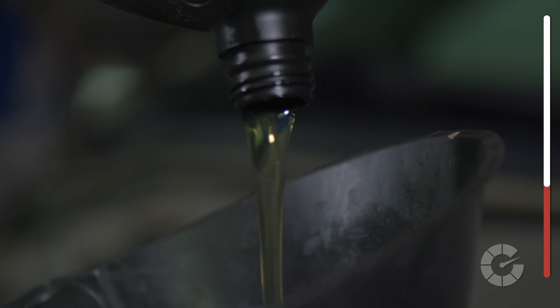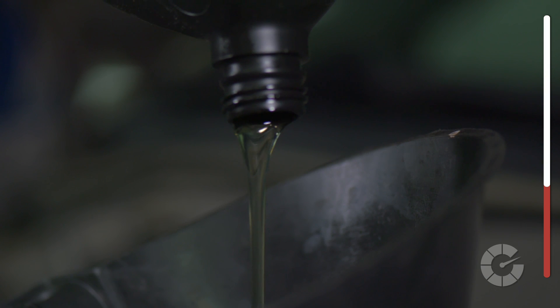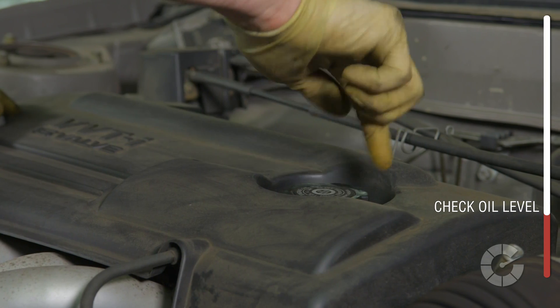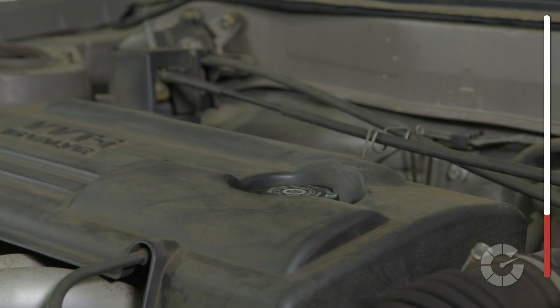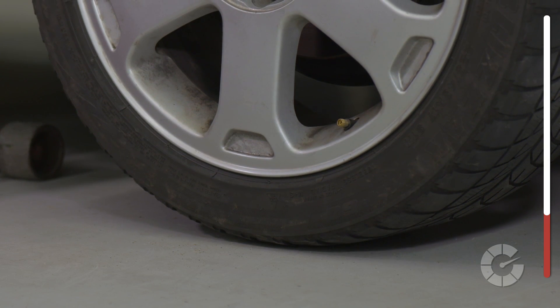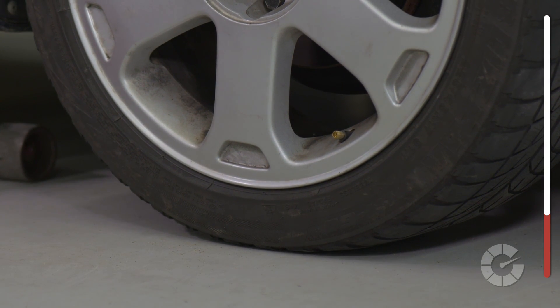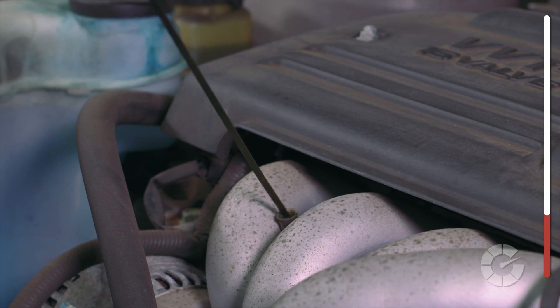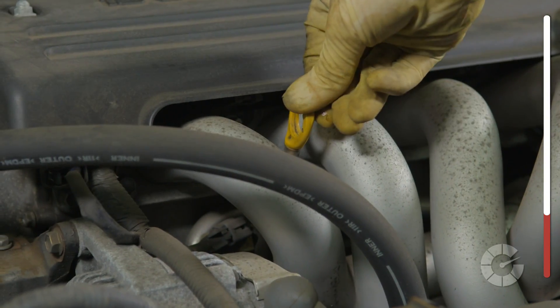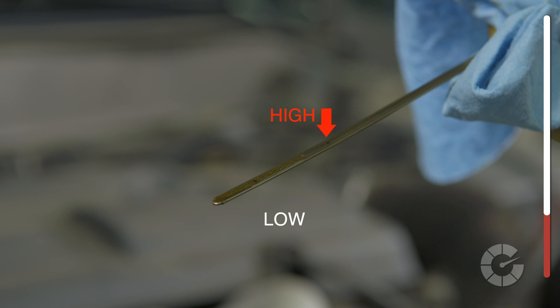Be sure to use a funnel to avoid spilling. If you spin the bottle to the side or what feels like upside down, it will actually pour easier and with less glug. Once the proper amount of oil has been poured, close the cap and start the vehicle for 5 minutes to allow the fresh oil to circulate in the system. Turn the car off and make sure the vehicle is perfectly level or off the jack stands before checking the dipstick. Pull the stick, clean the excess oil, then insert the dipstick again fully before removing it and checking the level. There's typically a low and a high indicator — try to keep the oil up to but not above the high marker.